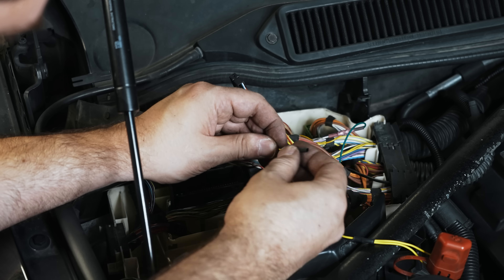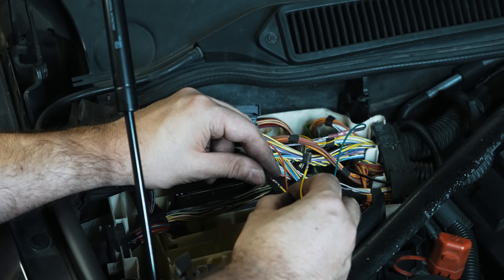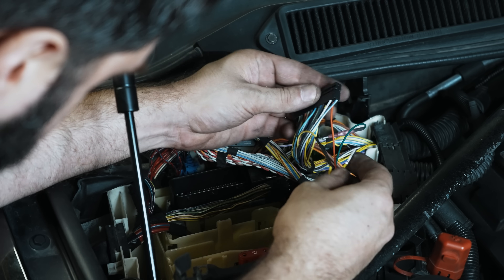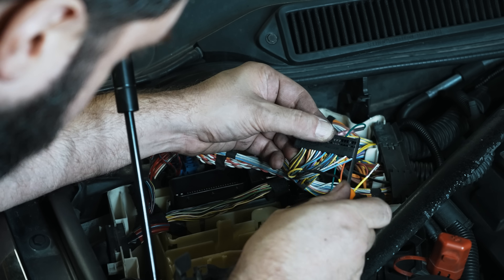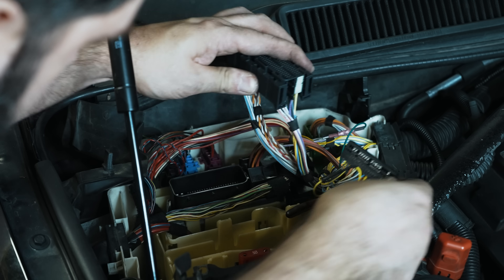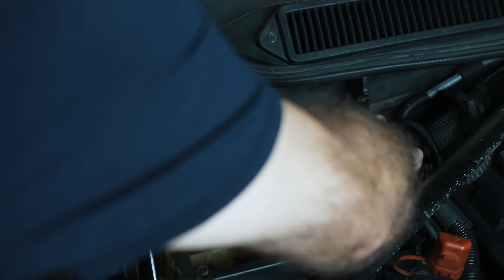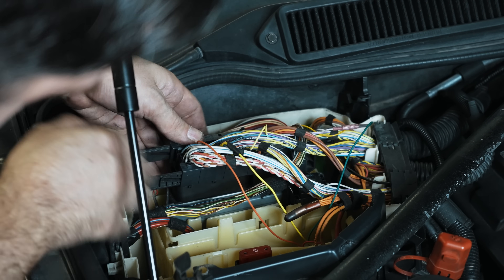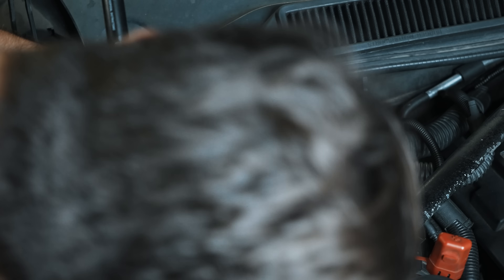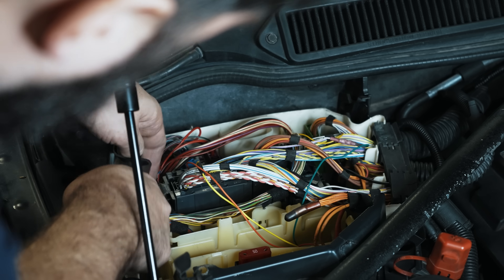Have heat shrink tube ready, slide it over, and bring the male end of the harness wire into the female wire you just extracted. Make sure there's a decent mechanical connection and that the heat shrink tube is tight-fitting so it holds it all together. The other end of this wire goes back into where you extracted from — count over to confirm position 9, 10 — click it into place. Be conscious that it doesn't come undone and route it so it won't get bound up. Reinsert the connector, and always tuck wires around corners since they can get pinched easily.